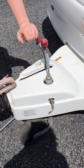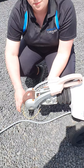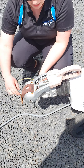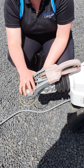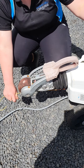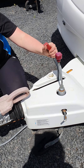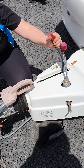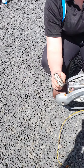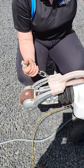You've got your breakaway cable, so you can either wrap that around the tow ball or hook that onto the shackle of your vehicle. This is designed so that if this hitch ever came off, the breakaway cable will pull and snap off — hence the name — and it'll put your handbrake on, so your van doesn't roll anywhere down the road. You've also got your seven-pin trailer plug for your lights, and this van is fitted with a safety chain.